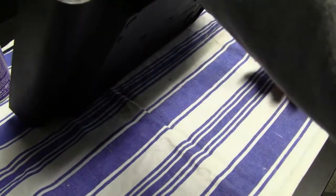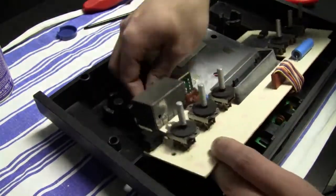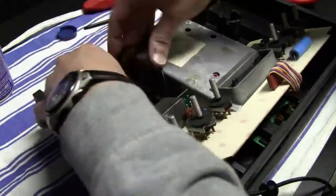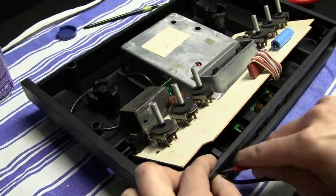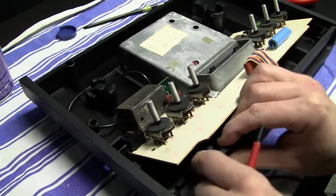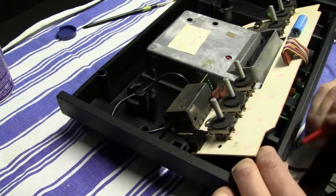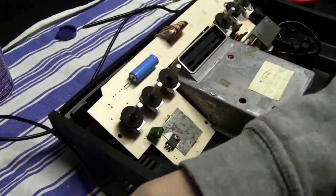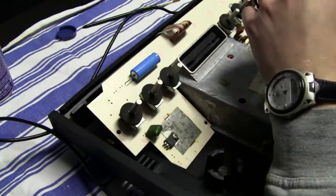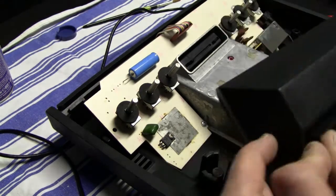Also, if you wash any kind of cases or anything and you wanna reassemble those, please let them dry. Don't be hasty. Maybe let them sit for 1 or 2 days. But if you really wanna work more quickly, then clean them and dry them with a towel, and also clean all those screw holes with compressed air, because again, you don't want any moisture or water inside your systems, because water and metal will react over time, and in the end you will end up with some rusty parts, maybe with some damaged contacts. So always let the casings and all the plastics dry, or dry them with some towels, paper towels, or pieces of cloth. And only when they are completely dry, then reassemble those systems or put them back together.